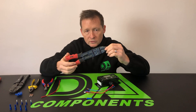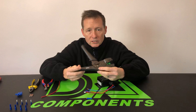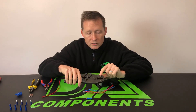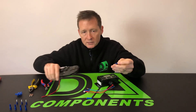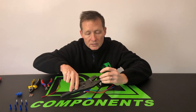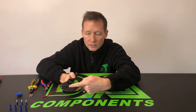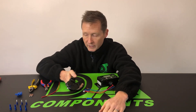My go-to tip: if you've got this, just don't use it. I would put that aside and invest in a ratchet crimping tool. You can actually see the colors of the different sizes of connectors. We use the bullet connectors, which I think are the go-to one. What you do is just slide it in where the color is, clamp it on, and that holds it ready for when you cut your cable to slot into there and then crimp it on.